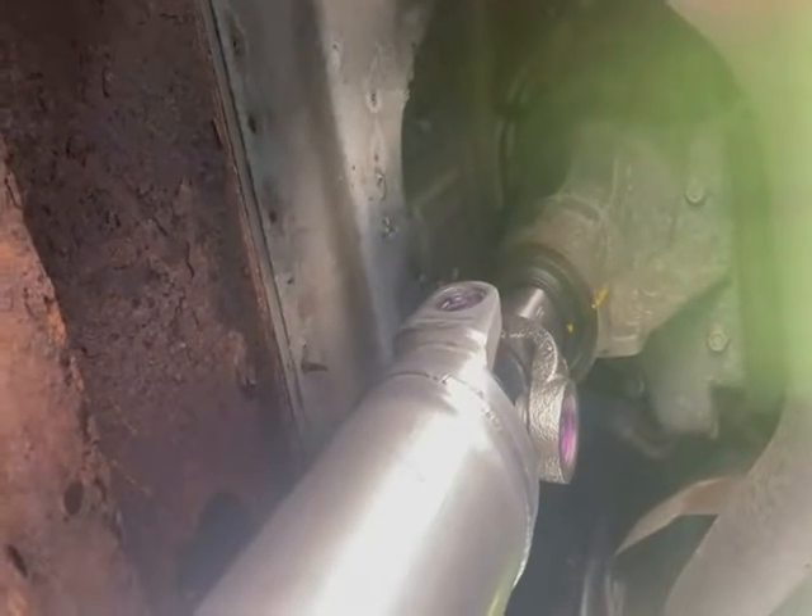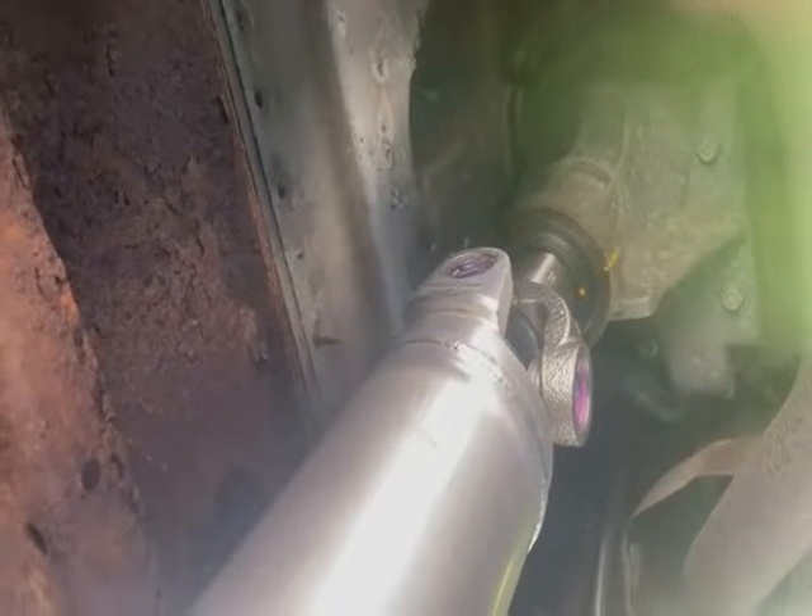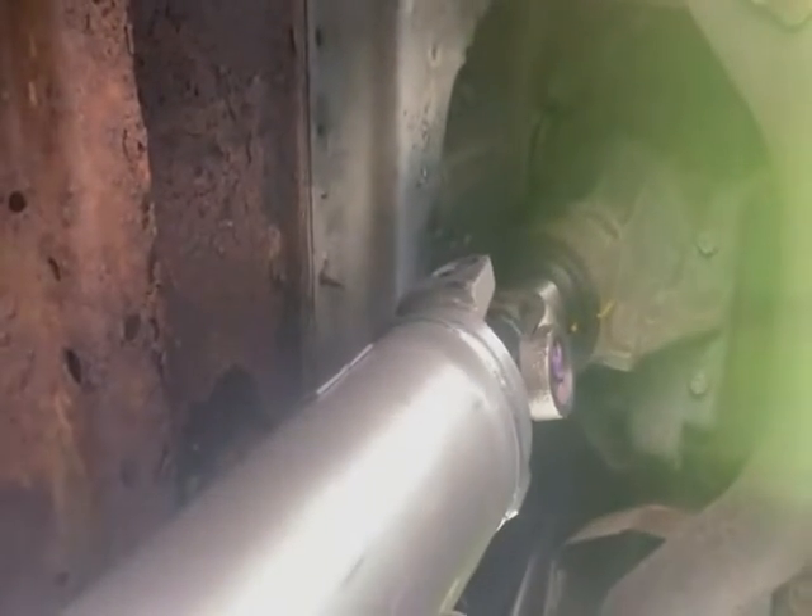That's how you're going to feel it if you've got stiff u-joints. Every slip yoke is going to have play, but if you have u-joints that are jammed and vibrating, that's one of the places where it's going to transmit through. The shaft is going to resist rotation and lift with each rotation. You may think that the u-joints only flex when going over a bump, but that's not the case — the diff and the trans are at different heights, and there is a little bit of movement in these joints even at ride height.